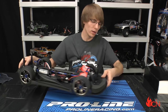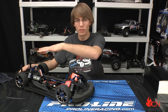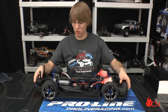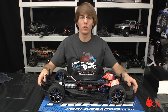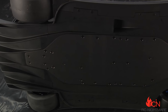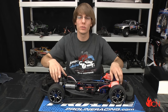The front bumper — this plastic piece rests pretty much flush with the body and it is a splitter of sorts. You want half the air to go over the top of the body and the other half to go underneath. The air that goes on the bottom would risk getting the thing airborne if they didn't create proper aerodynamics to compensate for that. On the backside we have rear diffusers — diffusers are a fancy way to lower the air pressure underneath the car.